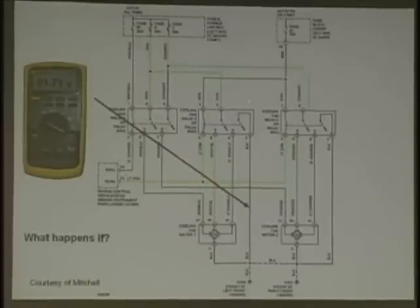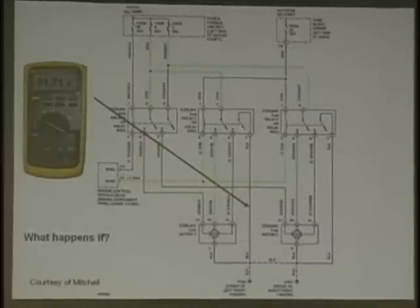Now, we're on this ground wire coming down. What part of the relay is this? Ground side of one of the motors. Okay, the ground side of one of the motors, which makes contact, because remember, it's multiple speed, all right? This is not a single, this is multiple speed. And again, we're in operation. So in other words, that relay is closed, both contacts, power and ground side. Remember, it's closed now. And that's the reading we're getting on that wire. All right? What would you expect to be happening?